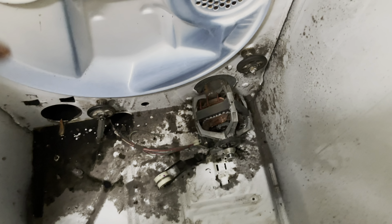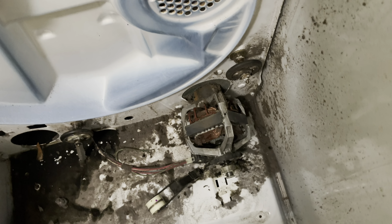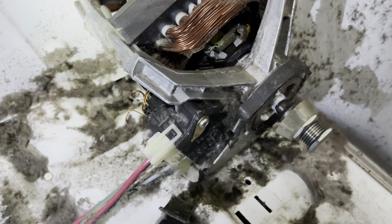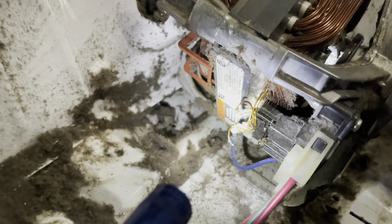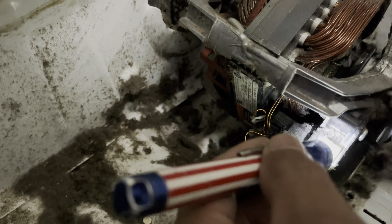Let's check if the motor is running. Okay, the motor is running really good, very smooth. But now I can see something came off down here — this wire right here just snapped off at the connection. I need to solder that. I think this is the control wire that runs all the way down to control the switch on the panel. That connection came off — that's why it's not turning.